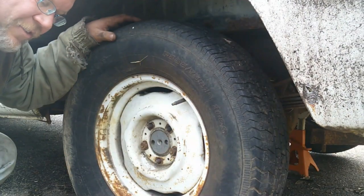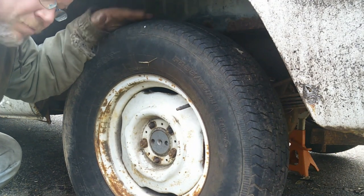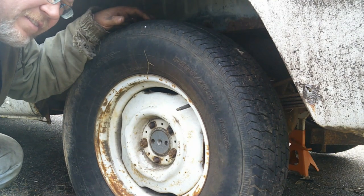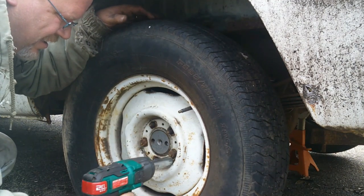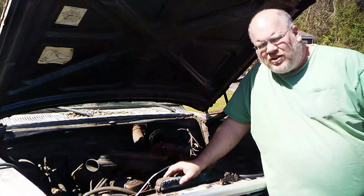I just really need to get to my trailer and this truck is in the way. I still need to bleed the brakes and do a couple miscellaneous things, but for now I'm going to put a couple lug nuts on so I can move the truck. On the Dodge, I'm getting ready to run a new brake line for the rears. I'm going to have to fish it between the gas tank and the frame rail, so I put some tape over the end so dirt won't get in while I'm fishing it. The tape also has a second purpose — there's a spot I think I might have a rub issue, so this is to protect the line, and it also keeps my flare nut from sliding down the line.